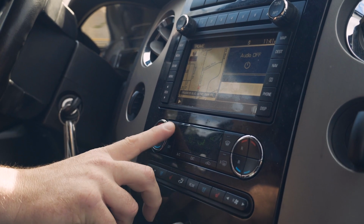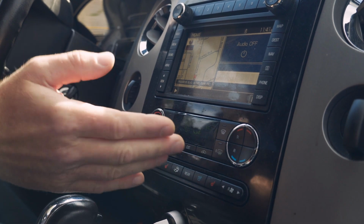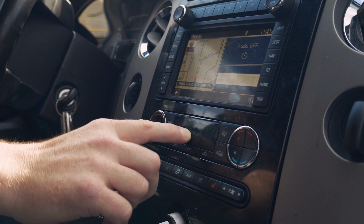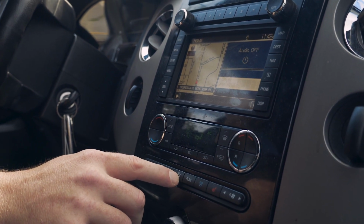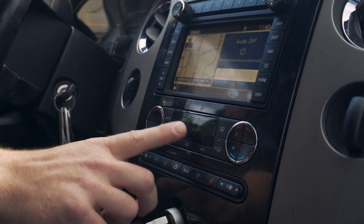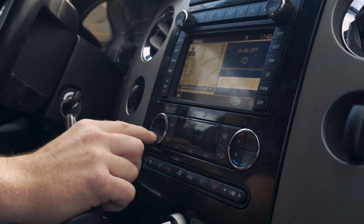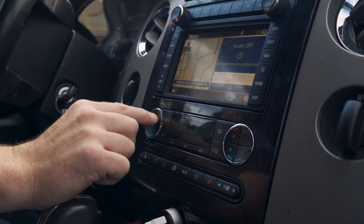When you're in the auto position and you go cold to hot, it will not only move the temperature blend door, it'll move the position of the airflow. Right now it's at foot, and you can change it to defrost, foot and defrost, vent and foot, right? I'm leaving it on foot now just to make sure that we're not getting a mode door change, because I heard something here. I am hearing some movement.